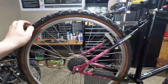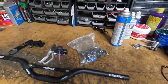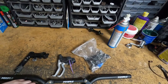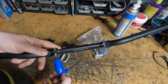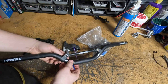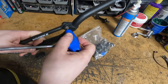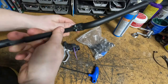1x9s would be perfect for just ripping around. Next, we can get this stem on. While we're over here, we're just gonna take this apart so we can get ready to put the bar on too. As I mentioned, we're just gonna have to take half of this brace off so we can get the quill stem on. It just comes off like that, and if we loosen this side a smidgen, I can just bend that out of the way.